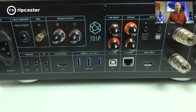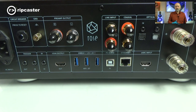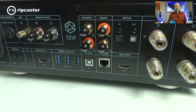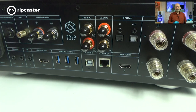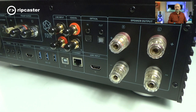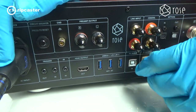Along the top we've got a line input for analogue audio. Next to that are a couple of digital coaxial inputs. Below that is a PC audio input over USB and the main network connection over Ethernet. Above that we have optical input and output — another digital option. Below that is an eARC input: connect your TV into this and you'll be able to listen to your TV sound through the speakers attached to the Rose RS520. And finally we've got the binding posts for left and right speakers.